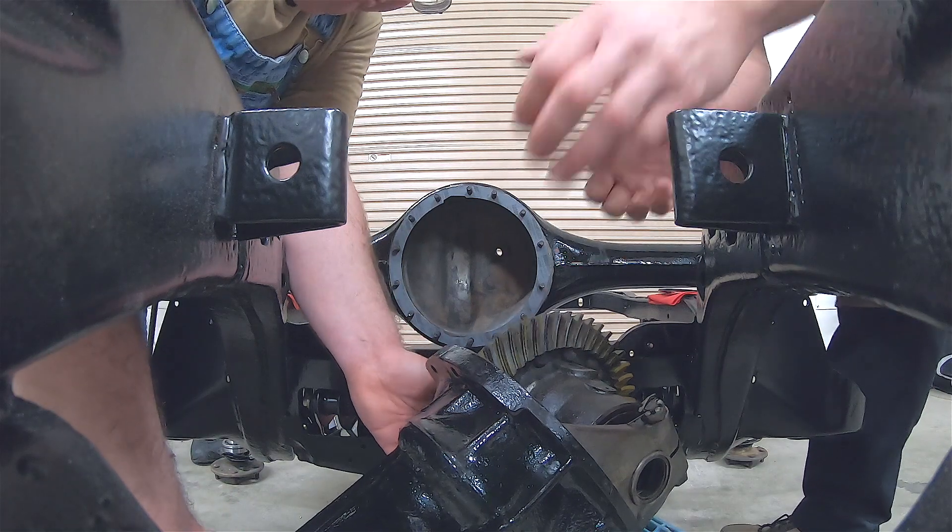So now what we're going to do is we're going to put the axles in the rear end. What we're going to do is we're putting the disc brake kit available from Caddy Daddy on here. One difference on the rear end is we're eliminating the backing plates of the drum brakes. If you're using your drum brakes, this is where you would put the backing plate on. Instead, right now, we're going to use this piece. With the Caddy Daddy kit, it has an engraving on it and a machined side. The machined side is going to go against the axle right here.